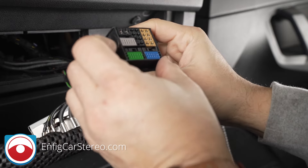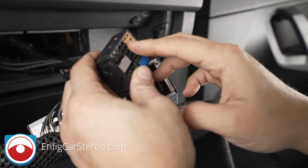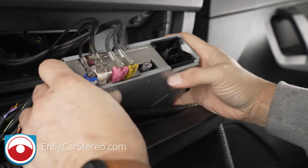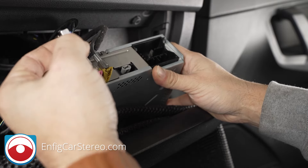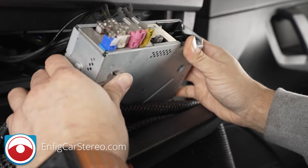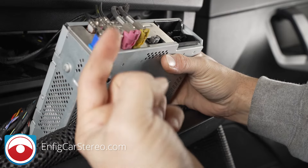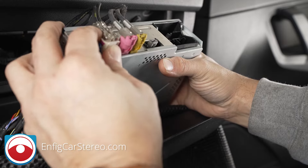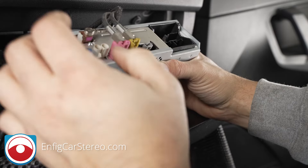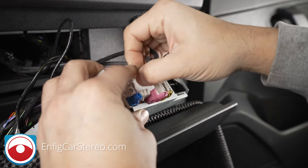If you have any questions whether or not you have an amplifier, better ask us than not. Now over here we have the blue — blue is usually a GPS antenna. It has a locking tab; you pull it out and then push it in. This comes out like so, and then push it in, it comes out. Those are usually pretty easy. This one same thing up here. Now over here, we have one of these which is USB and the other one is a screen. You're going to push that in and wiggle — don't just go crazy pulling because you'll break it. Wiggle. You don't want to pull hard and snap this in two because that's not going to be fun to fix.